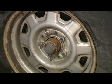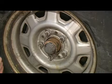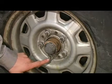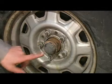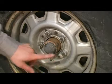We don't have to recheck on this one, so we're just going to tighten them down using the star procedure. The same procedure you use for snugging them down — we're going to start from here and move to here, from there to there, and from here to there, and here to there.